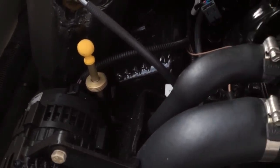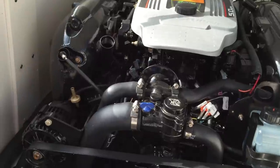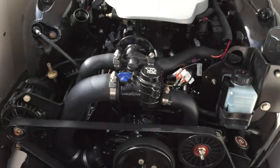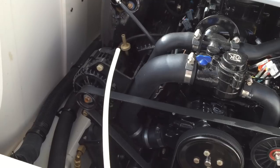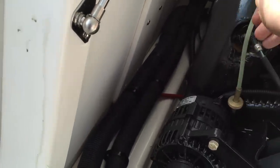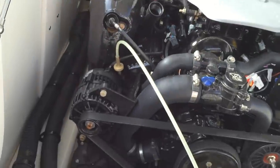The engine has already ran and has warmed up. So we're going to get started here. Take the oil fill cap off to help prevent any vacuum, set it aside. We'll pull the dipstick out, clean it off, and set it aside as well. We're going to start by putting the pump tube down the dipstick tube to vacuum out the oil. In this boat it should go all the way to the bottom — right there, just hit the bottom. It's in, connected to our pump. We'll vacuum it out. It should be approximately 5 quarts.